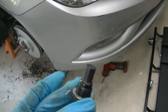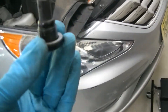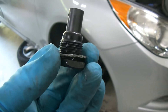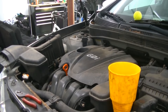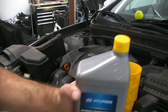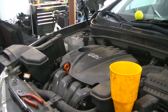Let's let that finish trickling and then we'll go ahead and start filling it up. Here we have our nice clean magnet drain plug — we're going to put that back in. You don't necessarily have to replace the crush washer; honestly I never have on the thousands of these transmissions I've serviced. Just snug it up a little bit to crush the washer a little more and you'll be good. Now, like I said, you're going to need six quarts of Hyundai SP4M — that's this stuff here with the yellow cap. Don't ask if I've used any other fluid in these transmissions; the answer is no. I know this stuff works, and it's what I use on all my customers' cars.